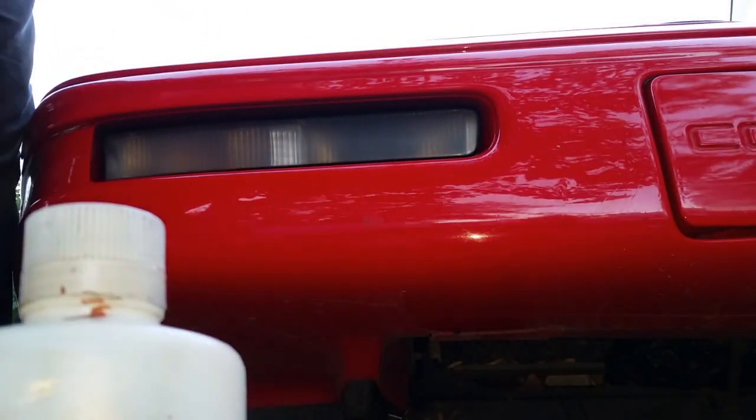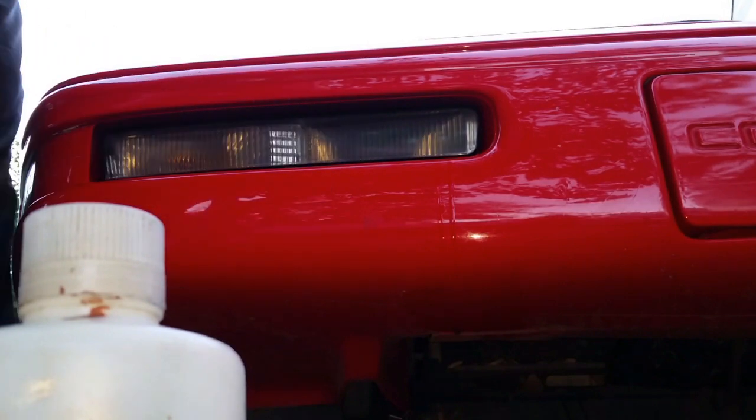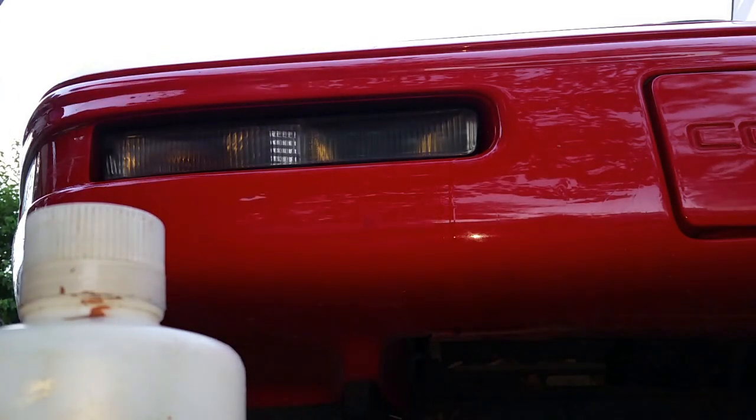When it comes to the acetone towel, fully saturate the towel with the acetone and do a single swipe across the lens. When it's done correctly you should see the residue of the oxidized lens on the towel. This is also why the towel must be rotated before making the next swipe — if this residue comes in contact with a lens with acetone, it will redeposit back on the lens.